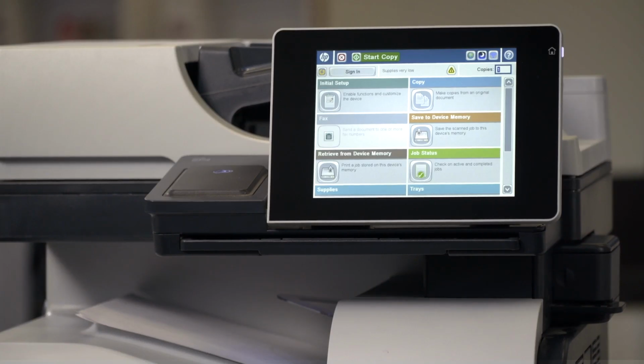You can see on the monitor that the malware code has been injected. It's starting to disrupt the memory, and we can see the words kernel stomp. This is indicating that the code is doing something it shouldn't. But notice on the control panel that nothing is happening. And this is actually the worst case scenario. The injected malware is inside the printer and going about its business, and yet no one knows it's happening.